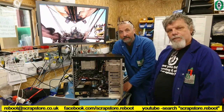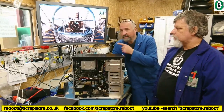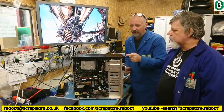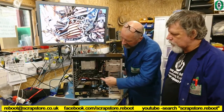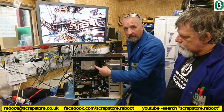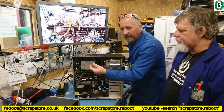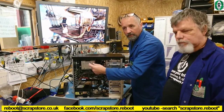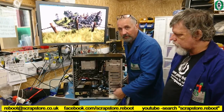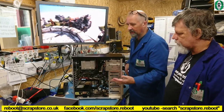Yeah. It's a few days later because we've had stuff to do, but we finally got the gamer ready now. Running some benchmarks, everything is looking sweet. So, to recap, it's all gone into a nice new Lian Li case. We've got the GTX 970 in there, 4 gigs, nice and cool. We've got this monster heatsink, which we had a considerable amount of problems fitting to get the 8-pin power onto the motherboard. We've got a 256 gig Crucial SSD boot drive and a 1 terabyte storage in there. Windows 10.